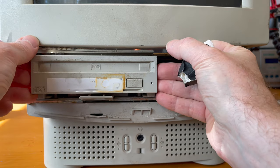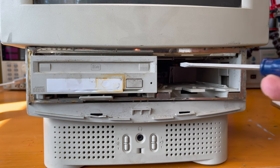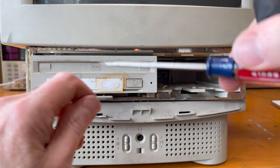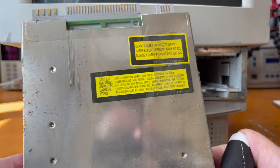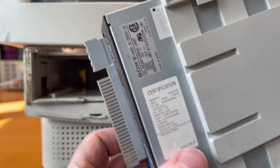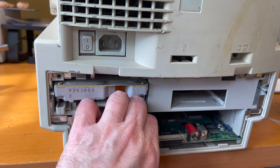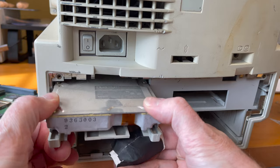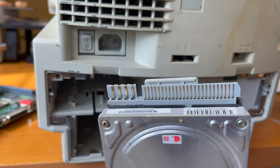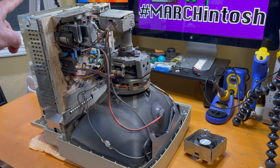And with some cajoling, I finally got the optical drive out. This is really stuck — I had to use a screwdriver gently on the side just to push it a little while lifting up the tab on each side, delicately, brittle plastic. The sled is still intact. Looks like this should be a CD 300i — yep, CDU 56125. Now back on the back side. Let's pull off the logic board and get the hard drive out. Get that connector loosened.